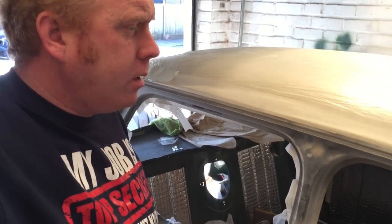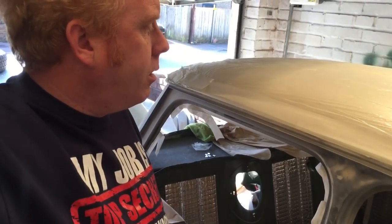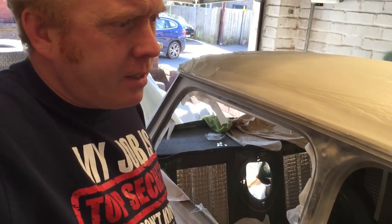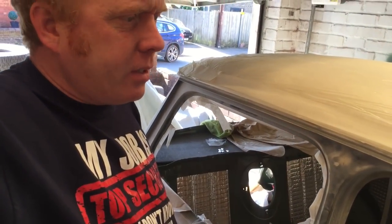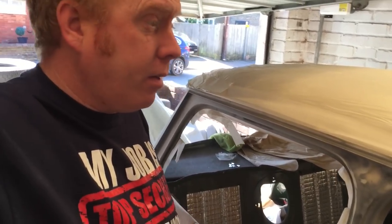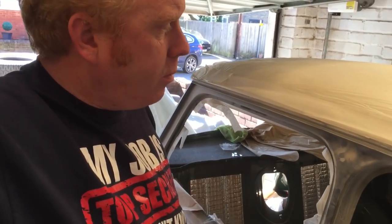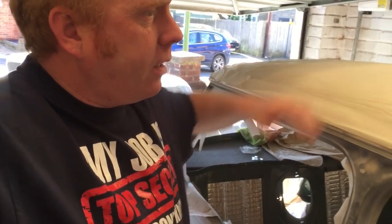First thing we did was mask up the roof, although I'm not quite happy with how I've masked it, so I might change it — the last thing I want is to get any paint on the nice clean roof. I'm not too worried about the top edges, I just don't want paint running down into the gutters, so I've back-masked along the gutter. I'm thinking I didn't really want to put loads of tape on the fresh paint just in case, but I think I'm going to have to. I might take this all back off again, put a nice bit of masking tape flat on the paint on the roof, and then back-mask it again — so the back-masking catches most of it, and worst case a bit of dribble goes through, the masking has caught it anyway, so you're really sure you're not getting anything onto the main roof area.